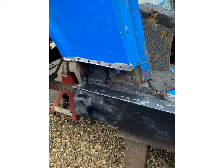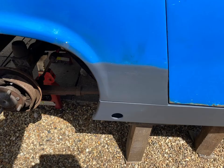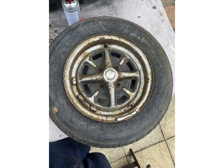This is another patch we've done — as you can see it was very, very rotten. We cut all of it out, ground it down to get clean metal to weld off. We spot welded using gasless wire as we didn't have gas in the welder, which is also cheaper. We filled it up, put some stone chip on to make it look flush, and tried to get the wheel arch back to the same shape with filler — it turned out quite well.